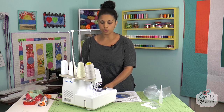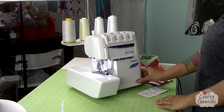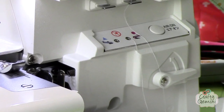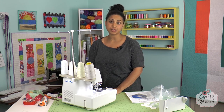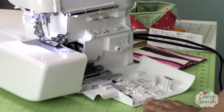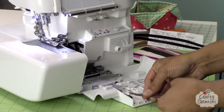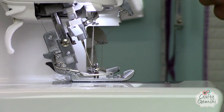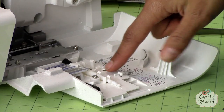Let's get started on showing you how to thread this thing. We'll remove the wastebasket and set it aside. Right down here I put my finger and this allows me to open it up and access where all the threading and looper stuff is. If you look on the inside of the cover, you basically have a built-in accessory kit — needles, a little screwdriver to change needles, a lint brush, and tweezers. There's also a color-coded diagram in case you forget how to thread it.